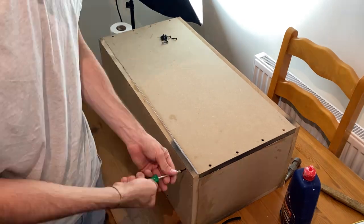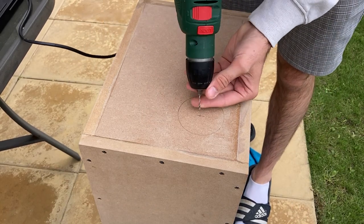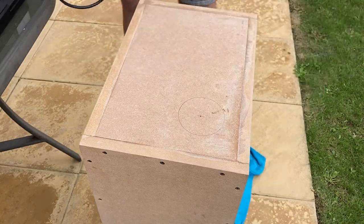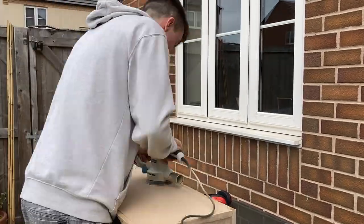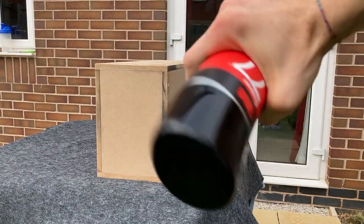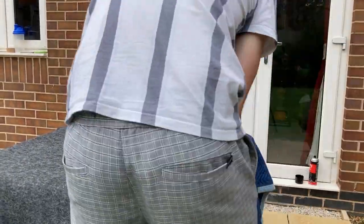I put the top on using screws, then hit the final inside edges with silicone using my phone's back camera so I could see what I was doing. For the circular cutouts, it's a simple process: drill a pilot hole in the center, bring your Dremel in with a router bit, set it to the correct measurement, and run it round before popping it out — that's how I did the terminal speaker cup. The whole unit was already pretty smooth, but I hit it once with the orbital sander to make sure everything was flush before carpeting the box. I've linked a great YouTube tutorial in the description for how to carpet a box, as it gives a lot more detail.